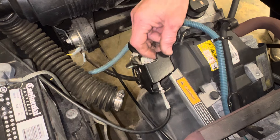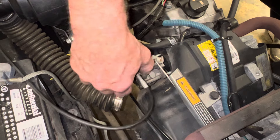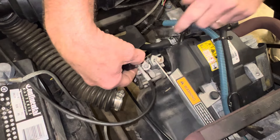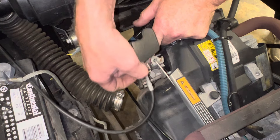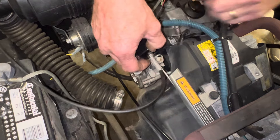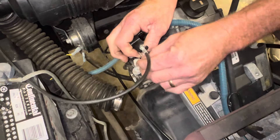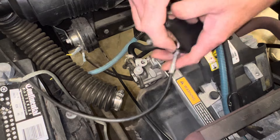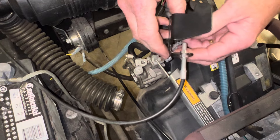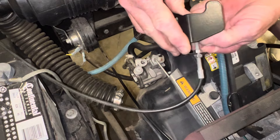What you want to do now — this is your choke plate gasket, this is your choke plate. What I'm going to do is pull it up. If you look at this, it's slotted. Take it, pull the choke cable around like that, and then pull it out of the slot. A lot of people do extra steps here, but I just bypass that, because it's less moving pieces, less pieces you got to put back together.